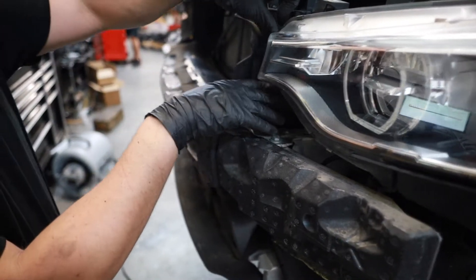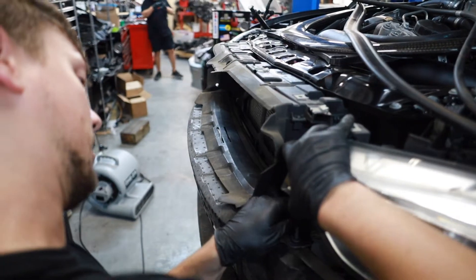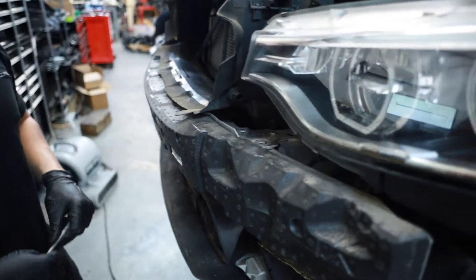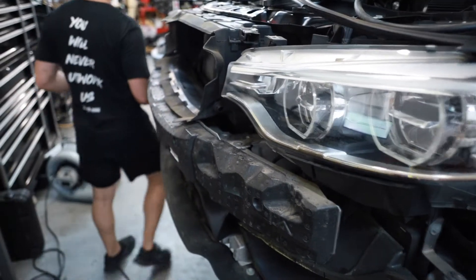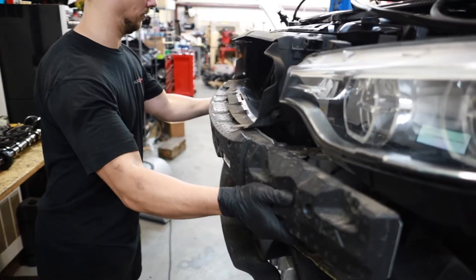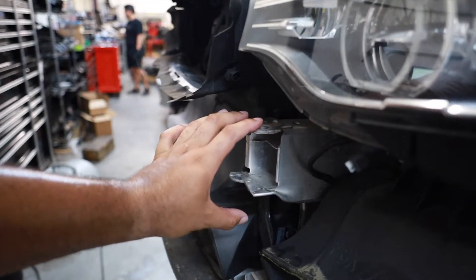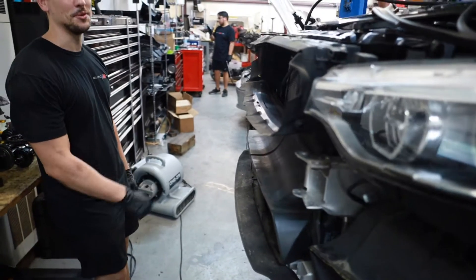This section here is your lens area — it's all covered by the bumper. When you pick this up it's going to kind of grab the headlight a little bit; you kind of take it out at an angle. You don't have to remove the headlight — you just have to gently persuade it. The bumper is officially off. Also, just to let you know, some more M badging — and you can see right there it says F8X.